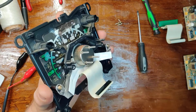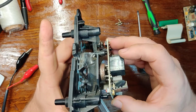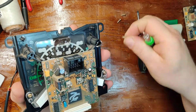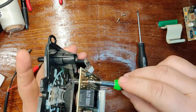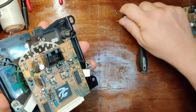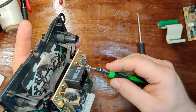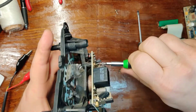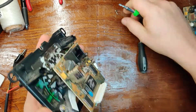It looks like it's in pretty good. Go ahead and grab our PCB. Slide it on the alignment pins. Give it a little press, and on it goes. If these are a little hard to start by hand, always put them on the end of your screwdriver. Usually they'll stay on a Torx head. Another trick to start a screw in plastic is to back it up a little until it falls in the hole — that lines it up so we know it's not cutting new threads.